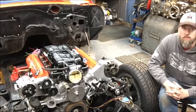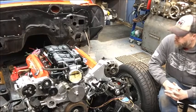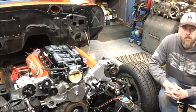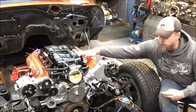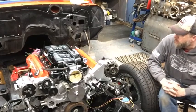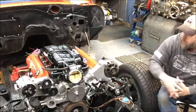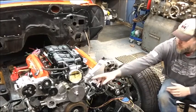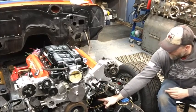The whole harness is roughed in. What we did as best as we could was hide every wire for every sensor possible. With the injectors we ran up to the back side of the fuel rails and running the injectors to the back of the intake manifold. That'll probably be the most visible wiring besides what's here on the TPS. We ran the TPS and IAC wires down behind the water pump along the side of the motor to the back.